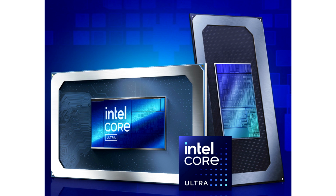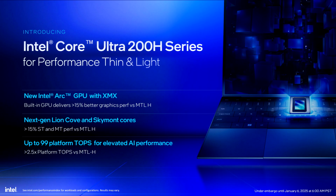As for the iGPU capabilities, the Intel Core Ultra 200H CPUs will be equipped with the updated Arc Plus or Alchemist Refresh chips with up to 8 cores, offering up to 77 GPU TOPS. The chips will carry full XMX support and allow the utilization of XeSS, bypassing the DP4A requirement. The iGPU is said to provide over 15% performance uplift over the Meteor Lake H iGPU. The CPU side delivers over a 15% boost in multi-threaded performance versus Meteor Lake H.